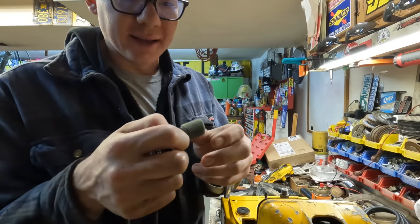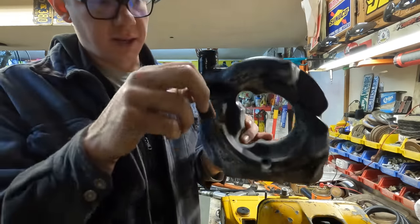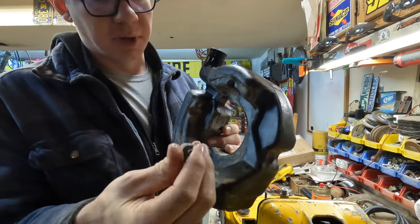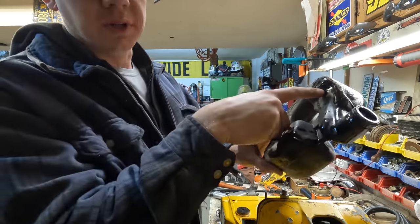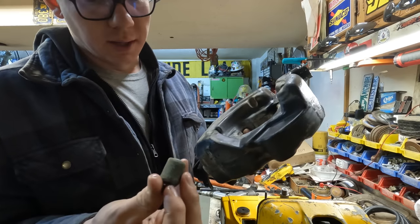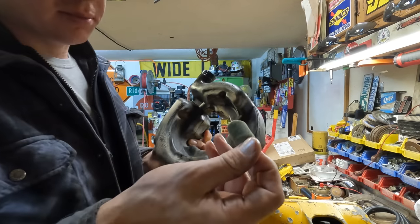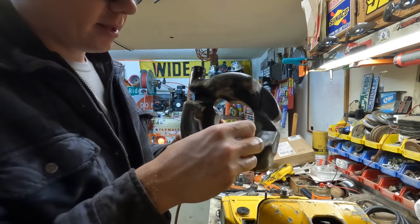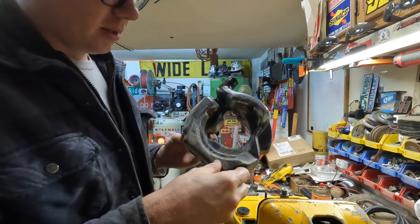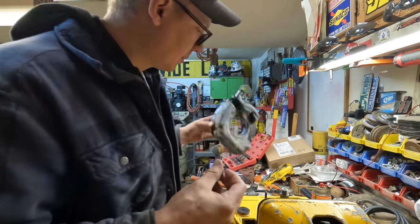Anyways, what this does is it hangs down in the fuel tank and has a fuel line running off of it. So it's just a pickup, and it comes out this hole in the tank over here. And it's the same way chainsaws and weed whackers all work. But anyways, this thing's got some gravity to it, and that way, no matter which way you rotate the machine, this thing goes to the lowest point and stays down in the fuel.